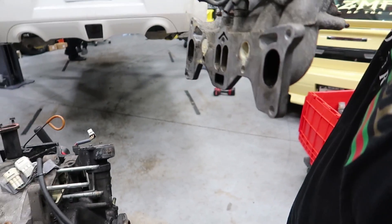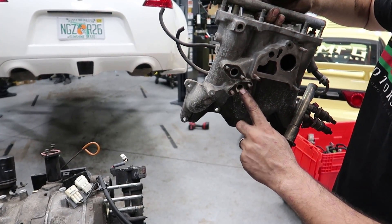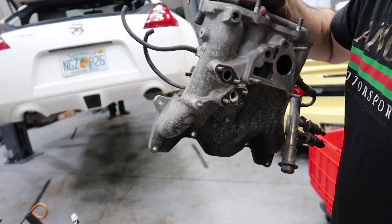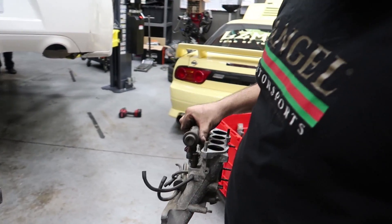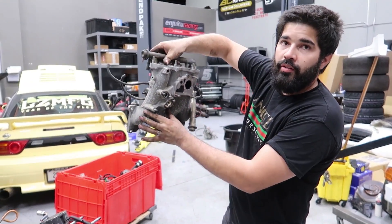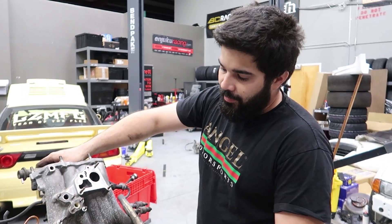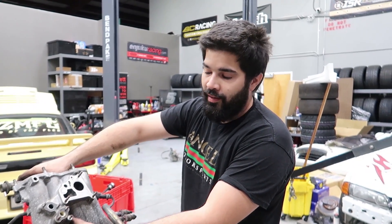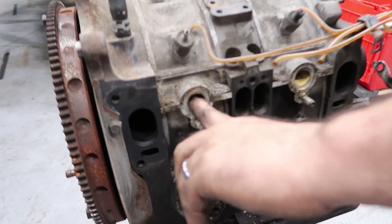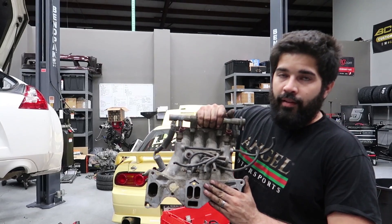This right here is a coolant port. Coolant comes through here — one of them is blocked off on the intake. This is the one that feeds coolant to the turbo. You want to block this off because you don't want hot antifreeze heating up these two runners. Part of the reason these engines blow up on the rear a lot is that coolant passes right between these two ports, making air temperatures way hotter in the rear rotor than the front. So you want to block off this coolant passage and if you have a water-fed turbo, run the line from the water pump itself.